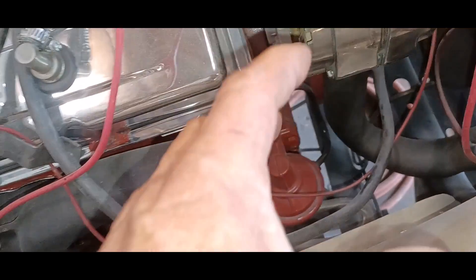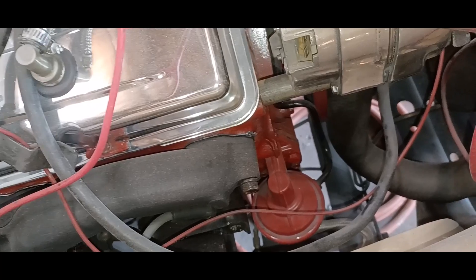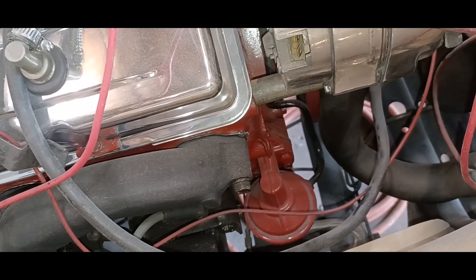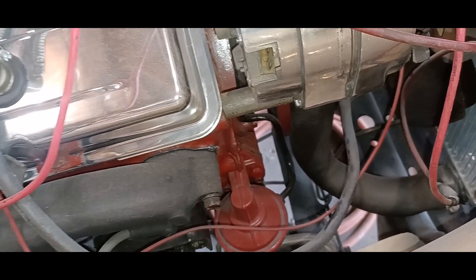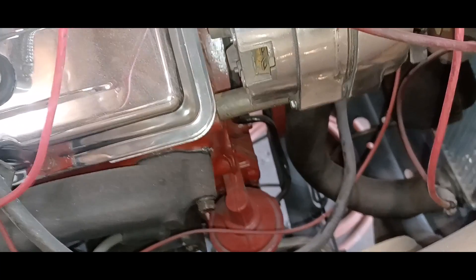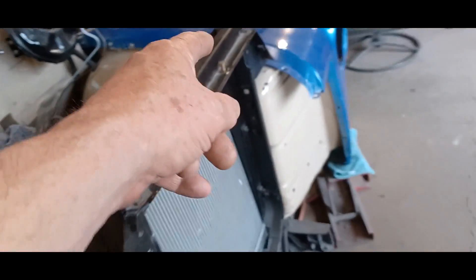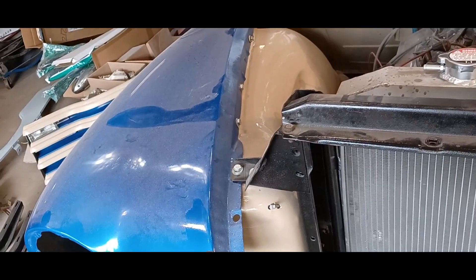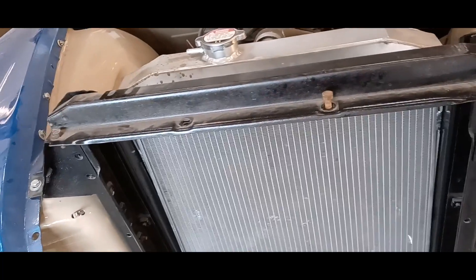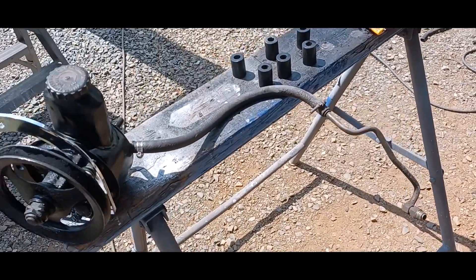While I'm in here, this lower rad hose is a problem — at the bend it wants to collapse, especially under high revs, and that cuts off your coolant. So I need to get a rad hose with a spring in it to fix that. That means I have to take apart the front fender on this side; the other side I'm leaving on because my wiring harness goes through it. But the fender, inner fender, rad support — all that is coming out.